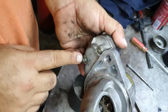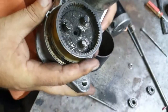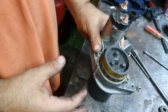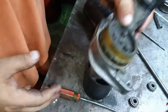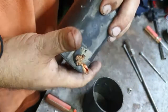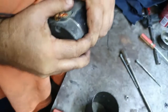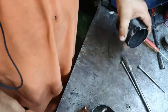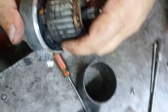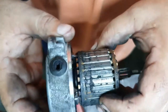now we remove these two bolts and disconnect this solenoid. This starter's only problem is in this area, this plastic, and this is the carbon brush. Here is a carbon brush. We also check this carbon brush, whether it is in good condition or not. The carbon brush is also not in too good condition,